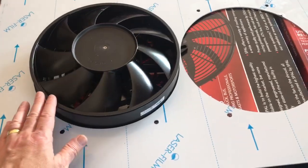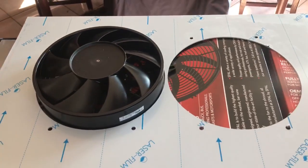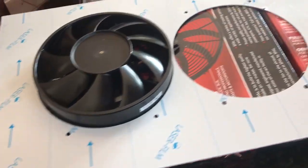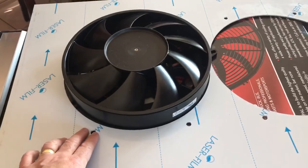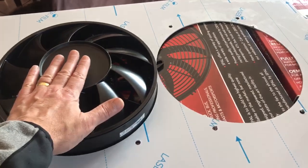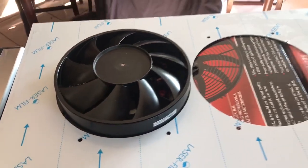What you're looking at is one of the brushless fans. This is a SPAL OEM brushless fan. It's 11 inches in diameter, and you can see this is the pre-cut or laser cut face of the fan shroud. This is a drop-in fan, so this is actually where the face of the radiator will be, and then it pulls the air through the back of the shroud.